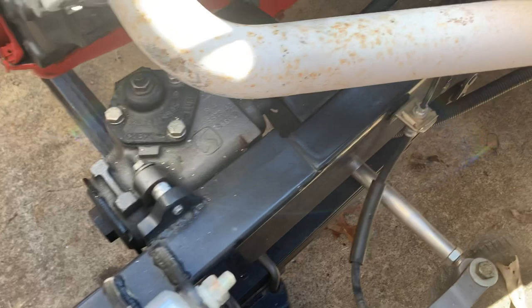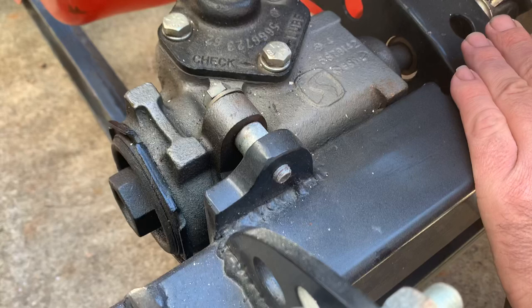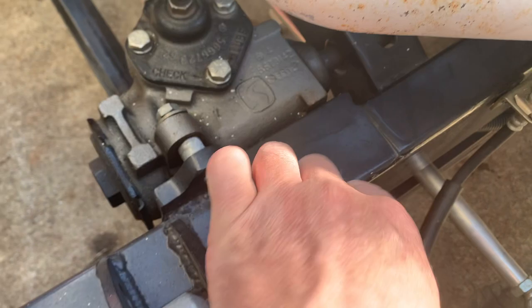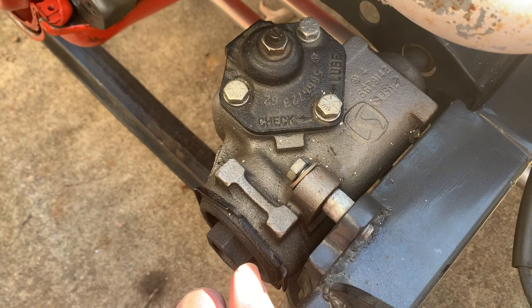On this car I built these motor mounts — I mocked them up and they've been fine. I run the steering through here, which is a terrible idea — I don't know what I was thinking — but it works. I'm going to end up putting a mid plate in. I built a mounting plate here out of thick steel for a 525 Saginaw box, used on any manual steering setup in a 1960s GM car.